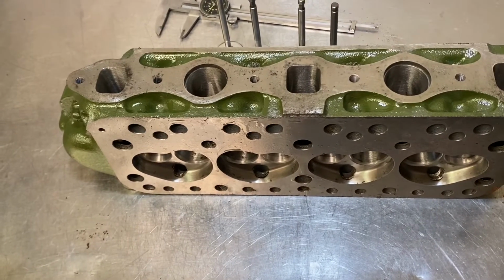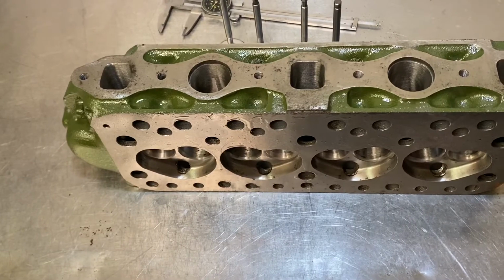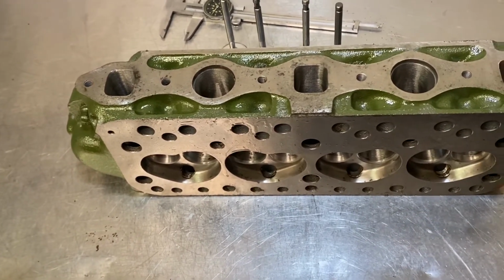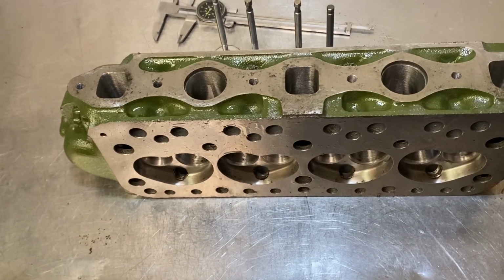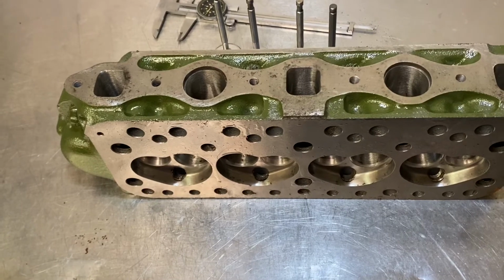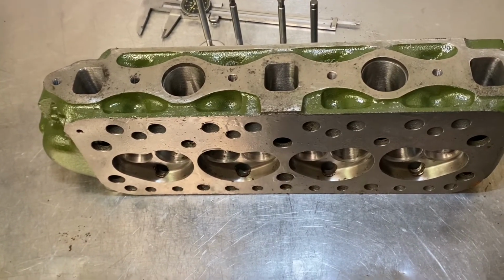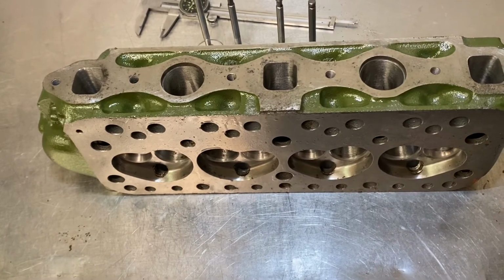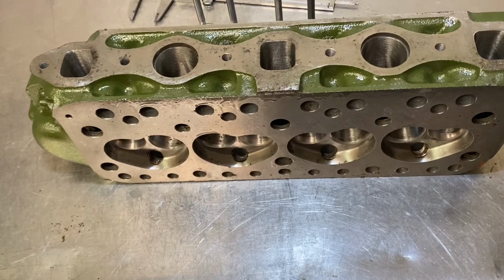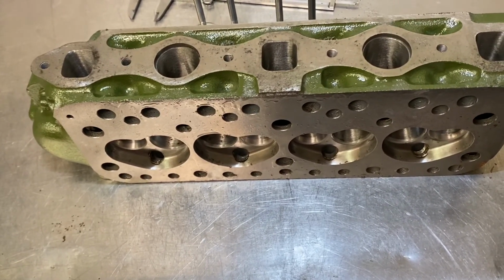So in standard form, these are 28cc as opposed to the standard chamber 998 head, which would be sort of 23 to 24. After modification, these are 30 to 33. That's a volume you can get quite easily, and if you want to go bigger than that, there's still enough meat to do that. So on a 998, obviously that makes the route to a low compression engine suitable for supercharging a much easier way than trying to source some deep dish pistons.